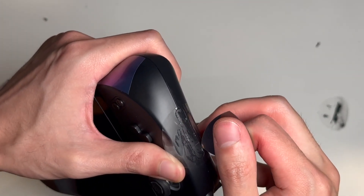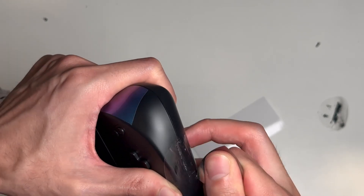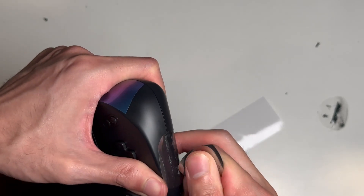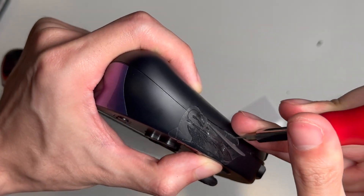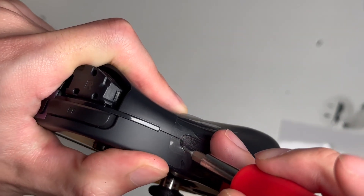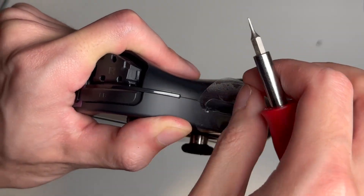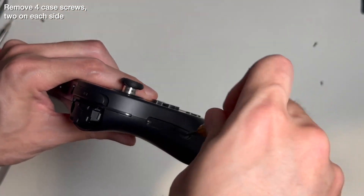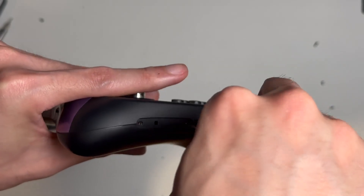I struggled like this for almost 10 minutes before I gave up and used the metal pick that came with the plastic tape. This thing will scratch up your case if you're not careful, and it'll really mess up the side cover too, but at this point you kind of have to. In theory, the goal is to get the pick to carve into the side cover from the underside of the Aya Neo near the triggers and then wedge the cover piece upward. This went on for almost 20 minutes and the side piece is pretty destroyed, but it's still not budging. Eventually I gave up and used a really small flathead screwdriver to dig into that corner, and eventually the double-sided tape gave up. On the other side I just skipped to the flathead. Unfortunately the flathead is so sharp that it also nicks the main case. It's not the end of the world because I'm hoping to replace the case with a white one eventually, but it still sucks — that's what I get for not following instructions. If you've made it through all of that, there are four more screws under the side covers, for a total of six case screws. I hope it doesn't take you 40 minutes to figure out the side covers like I did — this wasn't the most delicate part of the repair, but it was by far the most frustrating.